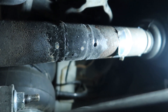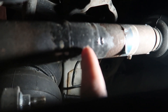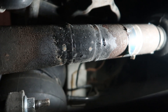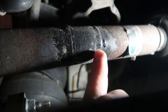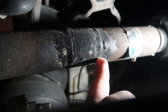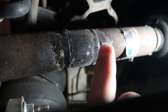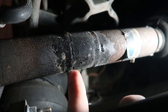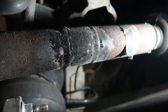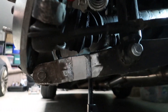That is something you will have to do if you want to get roughly the degree of camber that I have. In here — there's my cut axle. I had to cut it directly in the middle, milled the spacer down to the correct diameter, and put 45-degree chamfers on it as well. There are about four welds deep on each side — eight welds total around the complete diameter holding it in place. This was steel so it will rust if left bare metal; I grabbed heat-sensitive paint I had laying around and threw a couple coats on it.